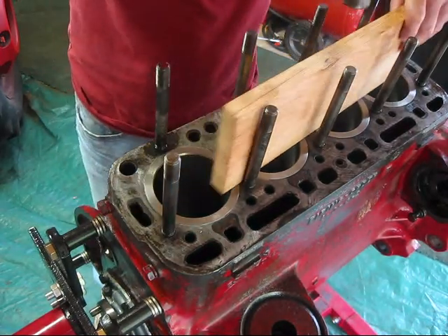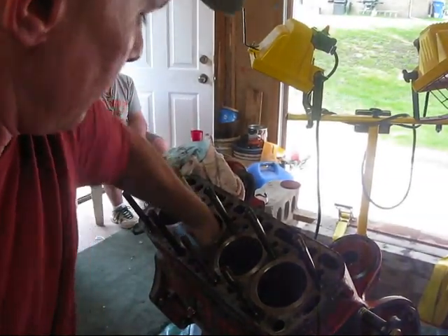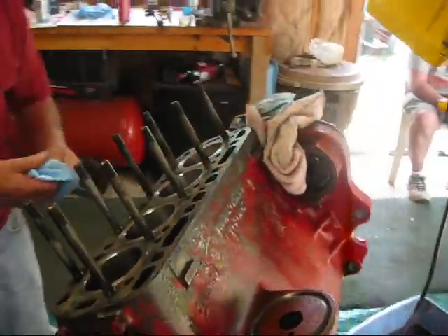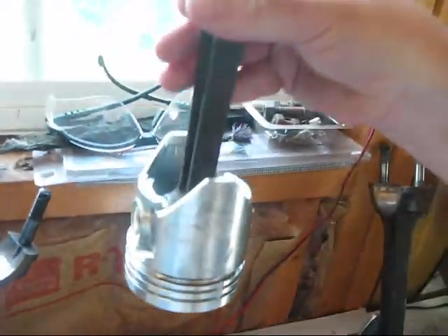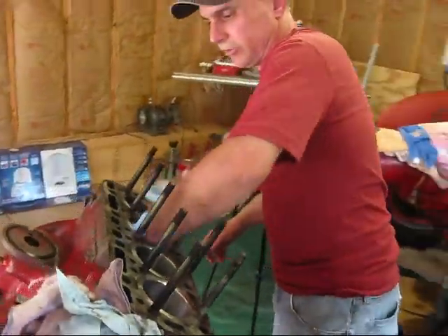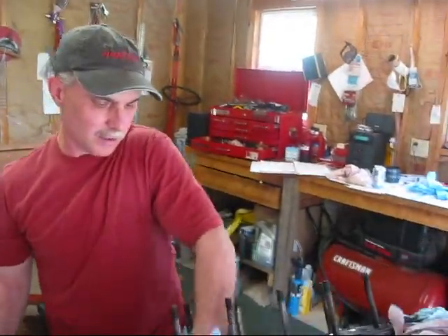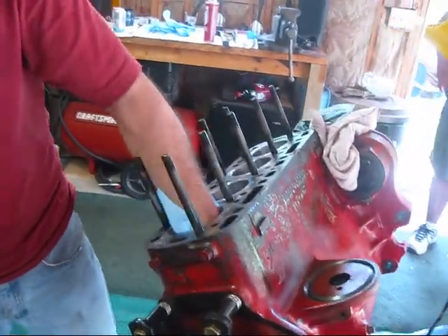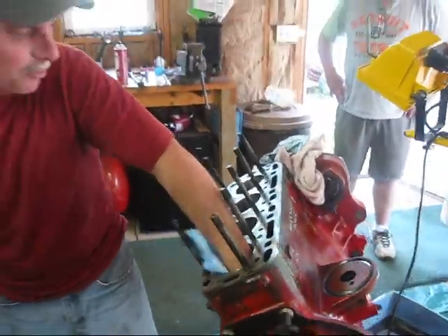The last two went different than the first two — the first two like snapped. Let's clean them out. Clean out the cylinder sleeves, get the oil out. Pressed them in — it didn't take very much. It took a little effort on the last two; the first couple went in with the hands. Had to use a little block of wood. They seated pretty good. Right now I'm getting all the old oil out that these sleeves and pistons came with, using lint-free rags.